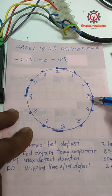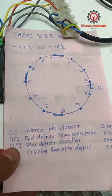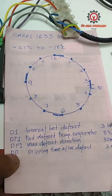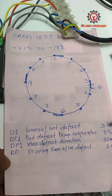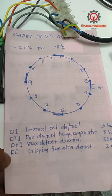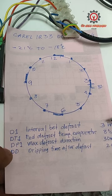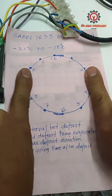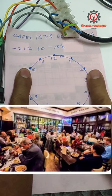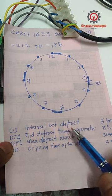This 3-hour interval is ideal if the store is not busy. If busy, just put it to 5 or 6. For example, if you put it to 6 hours, every 6 hours your unit will defrost. So in 12 hours you only have two defrostings — that's ideal for a busy restaurant.